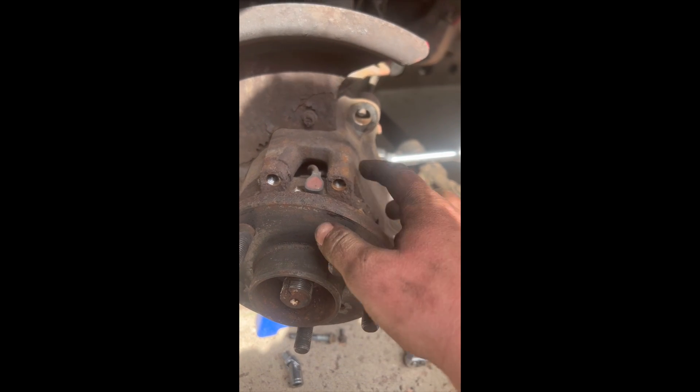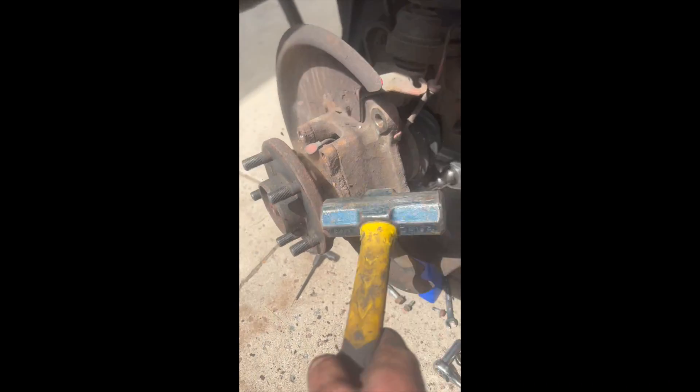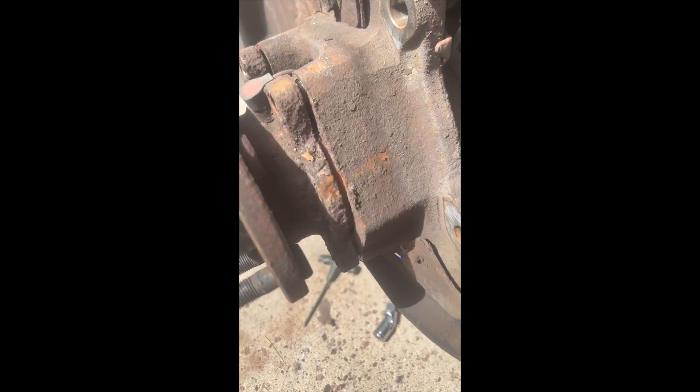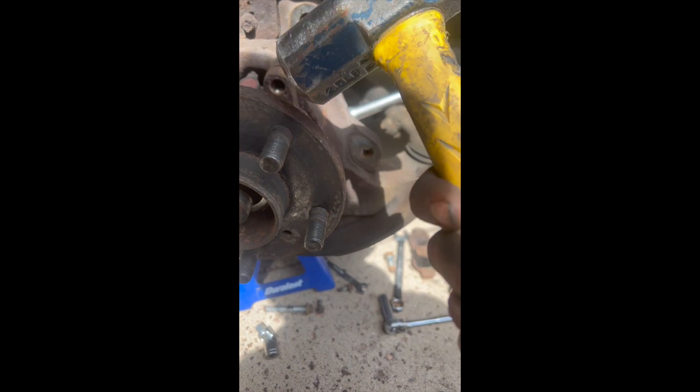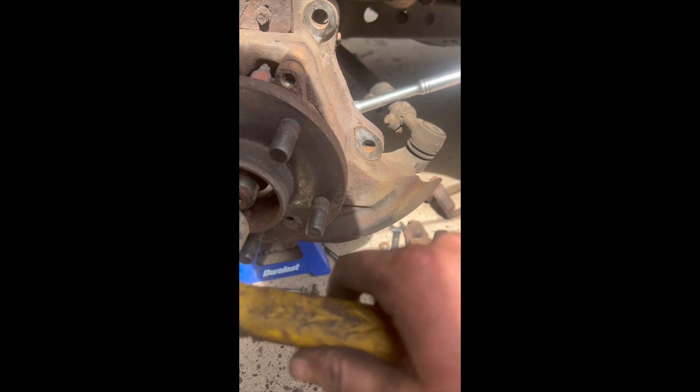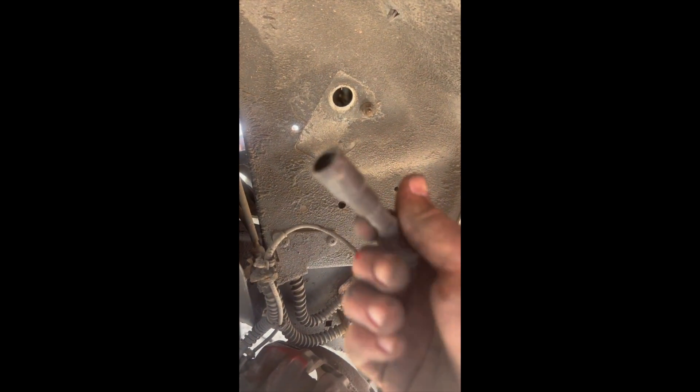I know you're hoping for a secret to getting these hubs off when they're rusted like this — all I can tell you is grab a big ol' hammer. Also make sure you don't take your axle with you. Don't hit it too hard — just kind of tap to get it off the threads. Usually if you smack the crap out of the hub, the axle likes to come with it. So just give her a couple taps and get her to go back in there. That's the ABS sensor where it comes down, and then there's a little bracket down here that holds the two sides. There's no real trick to get it out. Make sure your O-ring's okay on the actual sensor — they just pull apart. There's a little tab in there, but usually when they're old like this they just kind of pop out.